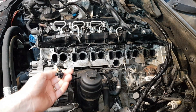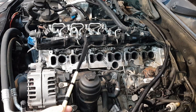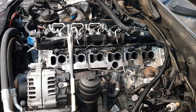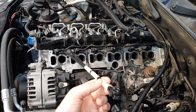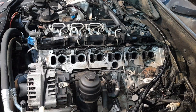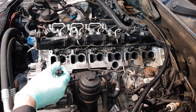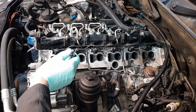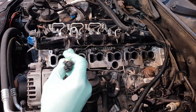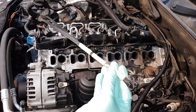I wanted to give you an idea if you're cleaning intake ports — this is a great way to clean your ports and your valves without causing any damage. This is a nice, cheap, easy, quick way to do the job. So what I've done is I bunched up a few cable ties together. I'm gonna fit it on my drill — you can do it manually if you don't have a drill. Just literally shove them in, put some chemical brake cleaner, make sure the valves are closed, shove that in, and just agitate the ports as best as you can. You can reach the valves further down, spin this on low speed first then speed up, and hopefully this will do the job.